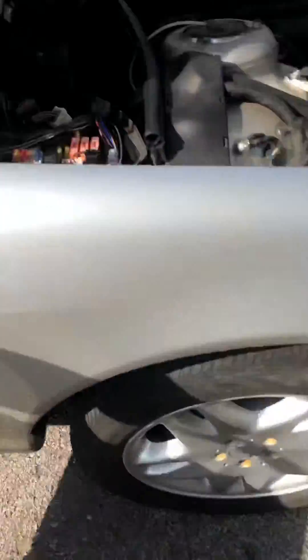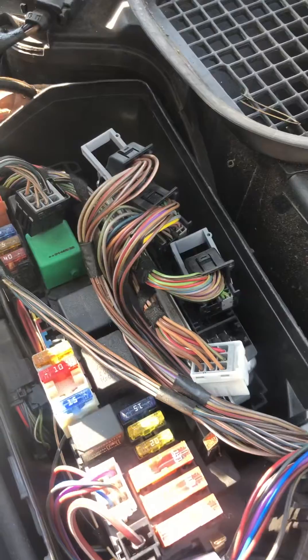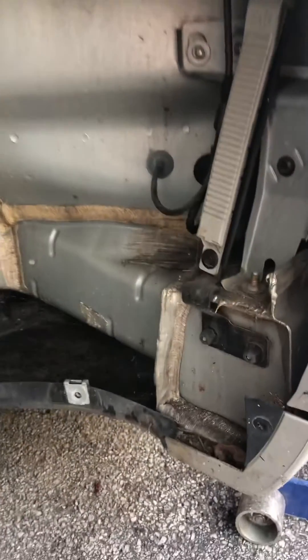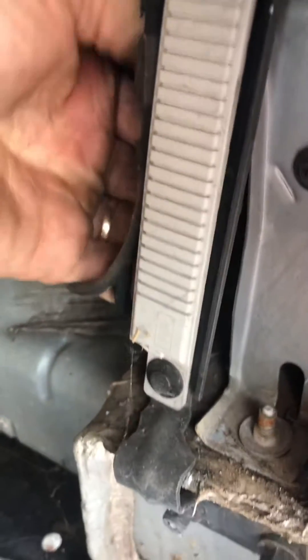The easiest one to get at was the ECM — I already unplugged it. The next one was the alarm; they've got it inside the left front fender well. Just stick your finger in there — unplugged. That went well.